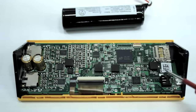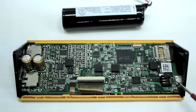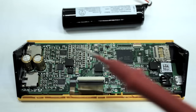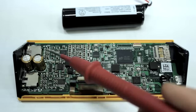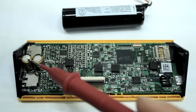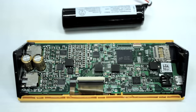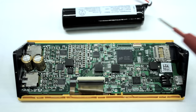Here's the backside of the Pono circuit board. Here's the battery and the 3-pin connector it was attached to. This is the USB connector, this is the micro SD connector, on this side are the two eighth-inch outputs, and here you can see some fairly large through-hole capacitors — those are 1000 µF capacitors at 6.3 volts, both of them.